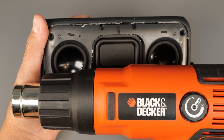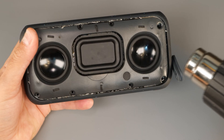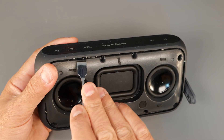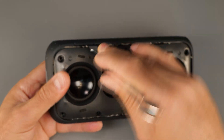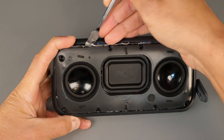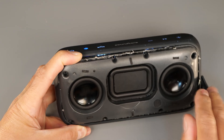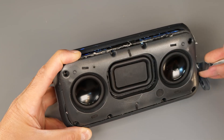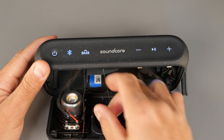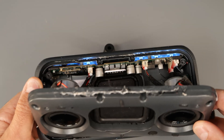I had to use a heat gun at very low temperature, focused on the sides. You have to be careful so you don't damage the drivers in the front. You need to go around slowly — there is strong tape all around — and once you get your prying tool inside, you need to lift off the front gently again until it eventually just pops up. It's extremely difficult to remove, so just be warned. But luckily, once you've got past the glue bit, everything else actually looks pretty neat — amazing. We expected lots of cables and stuff; this is actually rather a decent job.